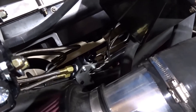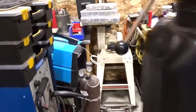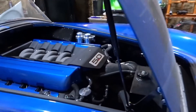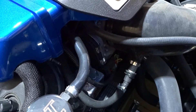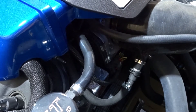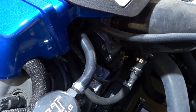All lines are tightened. The only thing left is to fill the system with fluid, which I'll do from the pump side on the other side of the car. It's a bit of a fun job because there's no sight glass or dipstick — you can see the cap is right here — so you need a long funnel. I'll pour the two cups of recovered fluid together, measure exactly how much came out, add that amount back in plus a little more, and then once we start the car and bleed the system, we'll know how much more to add.